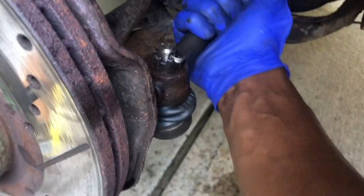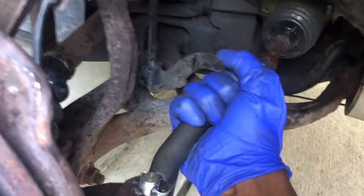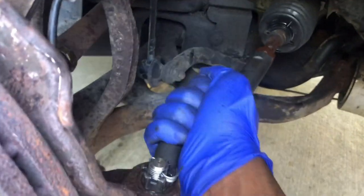Now we do another check — see that? No movement. That's what we're looking for. And no movement back here on the inner tie rod — this is your inner tie rod, this is your outer tie rod. No play, and that's what we're looking for. And that's how you do an outer tie rod change on a 2010 Mazda 6i — the S is probably just about the same. And that's how you quickly do it in a sense, and how you slide a little bit if you're trying to get away from doing a wheel alignment.